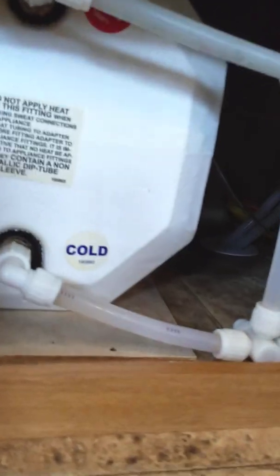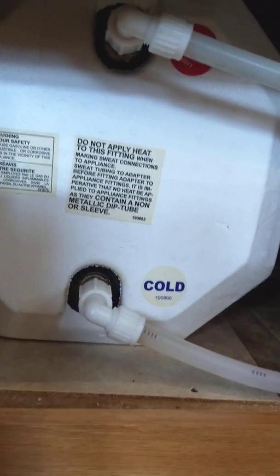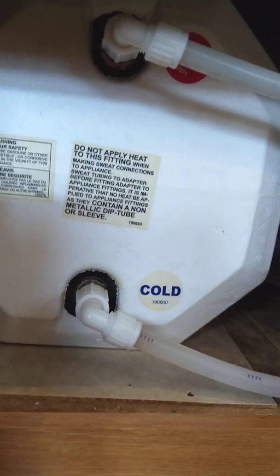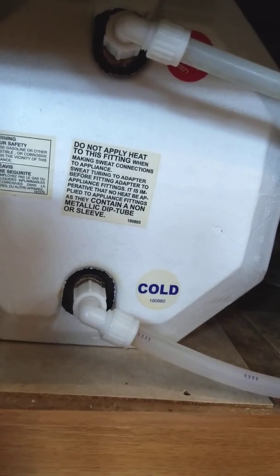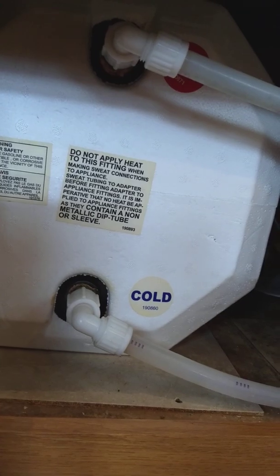Alright, now I can't go into winterization. You might already know this, you may be experienced, I don't know. The water heater has to be bypassed when you pump antifreeze in it or when you have antifreeze in the system. The reason is that it leaves a really foul taste in the water heater and a bad smell.